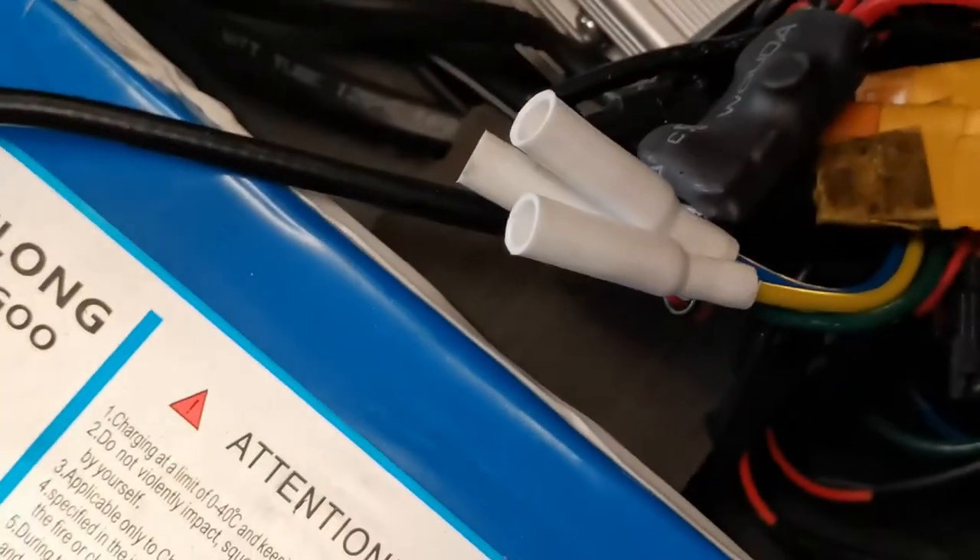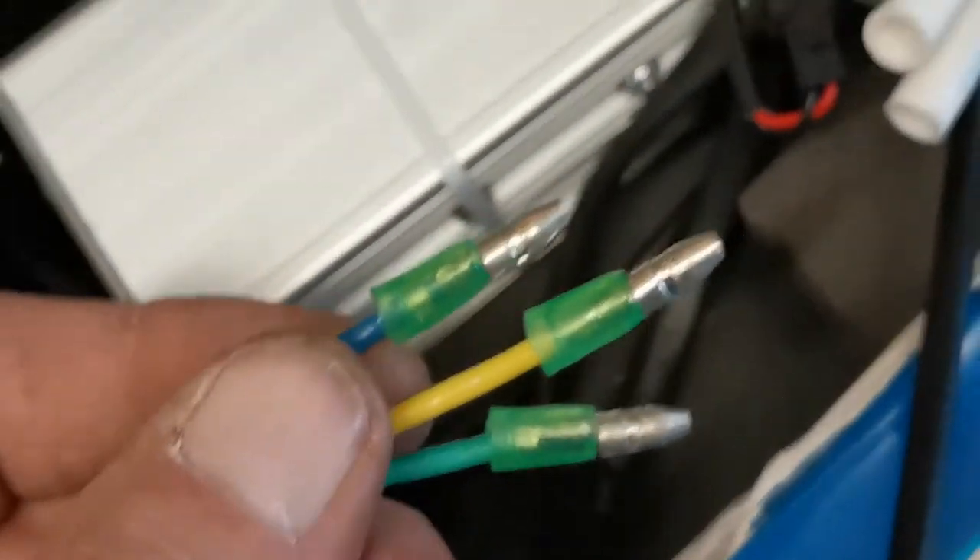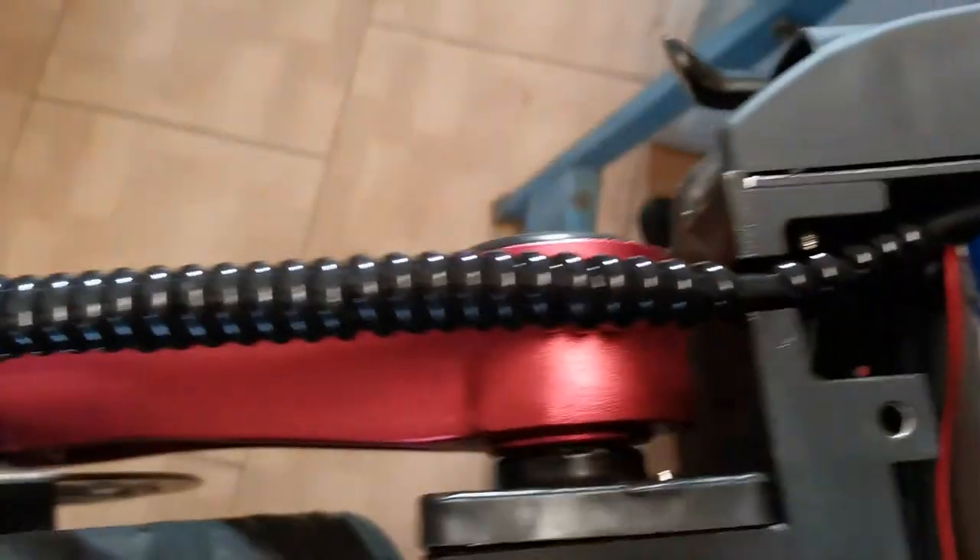Before you make the electrical connections, put the rubber bung with the hole in it down the cable and up over the nut. Once you've got the rubber on, bring the cable up to around here, measure it out along to the groove, get it sat down in the crease down the battery up to the front, and then redo the electrical connections — remember green to green, yellow to blue, and blue to yellow because it's the rear wheel.